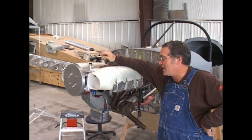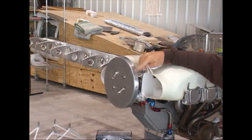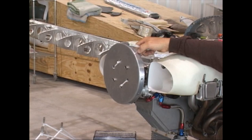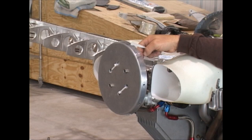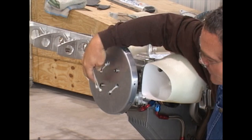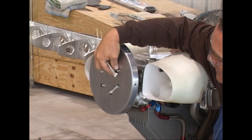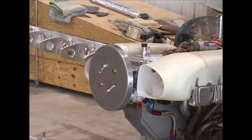We're ready to fit the cowling. The most important factor in fitting the cowling is making sure that everything lines up primarily with the spinner on the airplane. You want a nice fit all the way around the spinner so that you've got good smooth airflow. You want to shoot for at least a quarter of an inch or so clearance between the cowling and the spinner in final assembly. There is relative motion between the spinner, propeller assembly, and the cowling, so a little clearance is a good idea. To hold this in place, we'll insert a couple of the propeller flange bushings through the extension and then to the spinner back plate, and put a couple of tie wraps in to hold it. That will give us our reference to mount the cowling and fit it up.